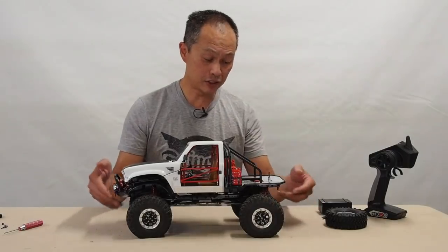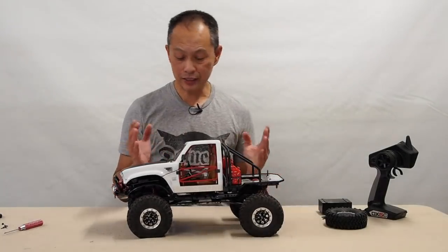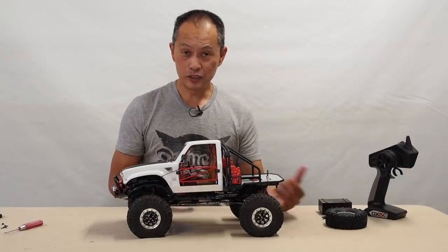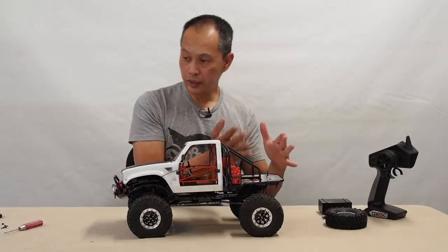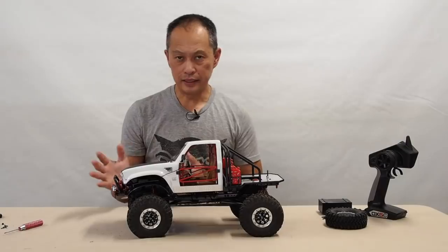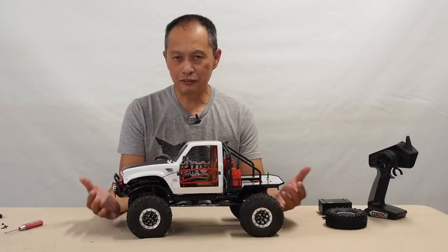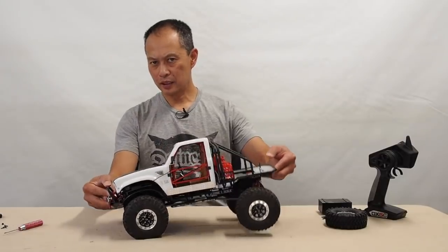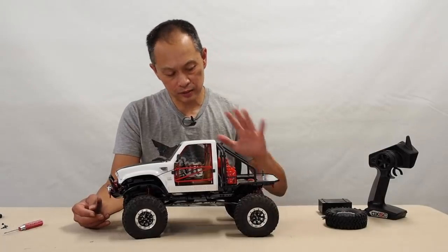It's an unbalanced suspension. I think they put the same springs on the front and the rear, and that's an issue because the rear is much lighter. According to my cheat sheet, 41% of the weight is on the rear and 59% is in front — that's pretty severe front loading. You've got to adjust the suspension so it will sag level. That's why you see this vehicle always tipping forward. Some people straighten out the shocks, some put lighter springs in the rear — it can definitely be addressed.